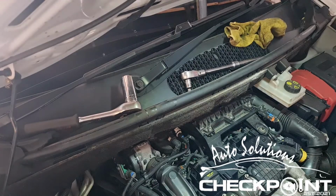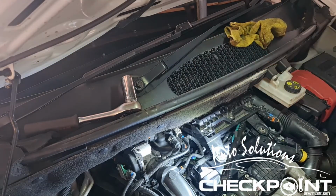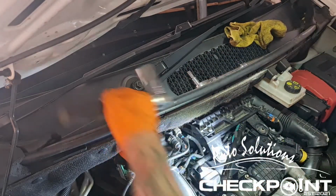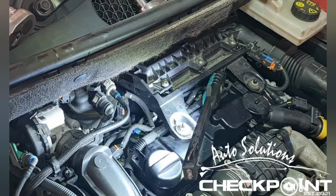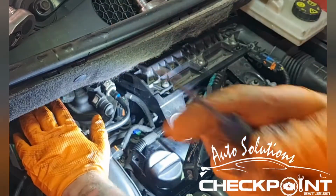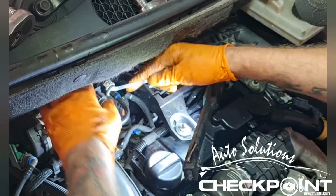Okay, the moment you have all been waiting for. We're doing the fuel filter. This is somewhere suitable to put the light. So, you will be needing an 8mm socket. You'll be needing a 24mm socket. You also need the wee dreaded hookie. Now, just got to reach in and disconnect all this. Always make sure the key is out of the ignition. Never ever work on a vehicle when the key's in the ignition, because you're only asking for trouble.